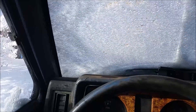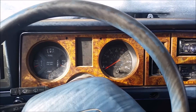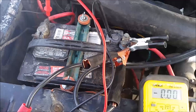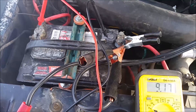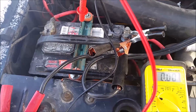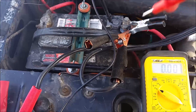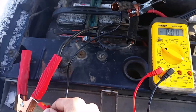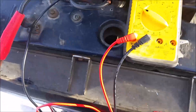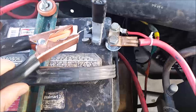I'm going to hook that solar panel up to the battery and see if it'll charge it enough to start the truck. I'll hook it up and come back in a few hours — should be working by then. Let's check the voltage and see what we got: about nine volts. The battery is not completely dead, we can still salvage it, but it's definitely going to need some charging. The solar panel is putting out about 19 volts — excellent. Let's hook this up.